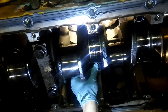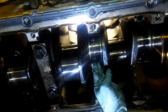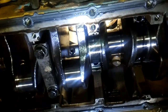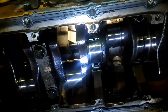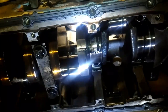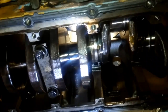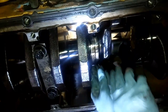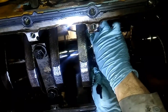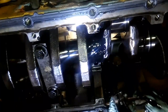We're pushing our bolt up — make sure it stays in place. I usually smooth the top of the bolt if it's got dashes or numbers on it, just so it's a smooth surface. It's up against the bearing, and as you rotate the crank — going so that the tab comes out first; you don't want to push the tab into the block — you can see the bearing just pulling right out as I rotate. It's going to leak a lot of oil because the oil galley is sealed up there by that main journal. It'll roll out and then just flop out because there's no tension anymore. Sometimes it gets stuck due to surface tension from the oil, but just play with it and it'll usually come right out.